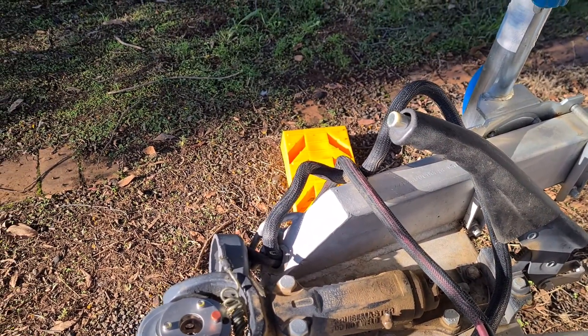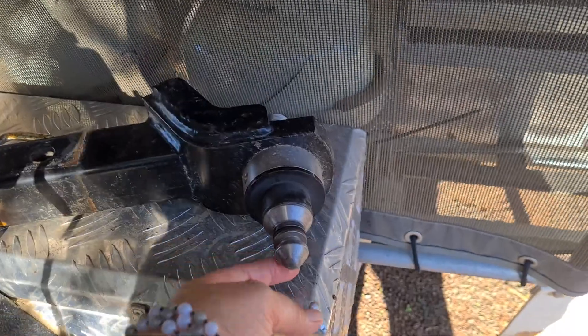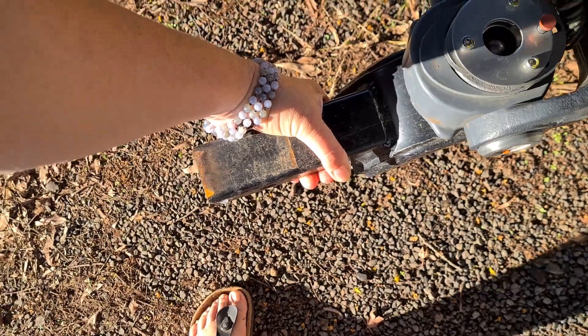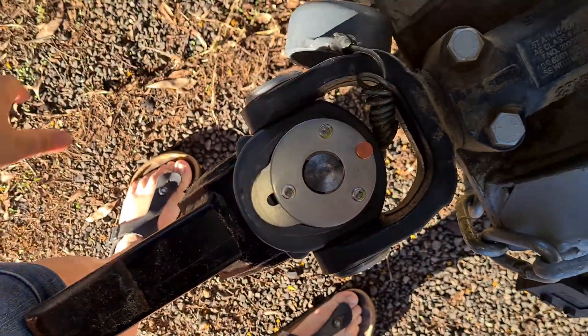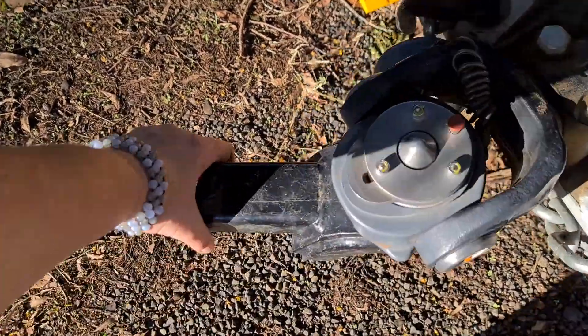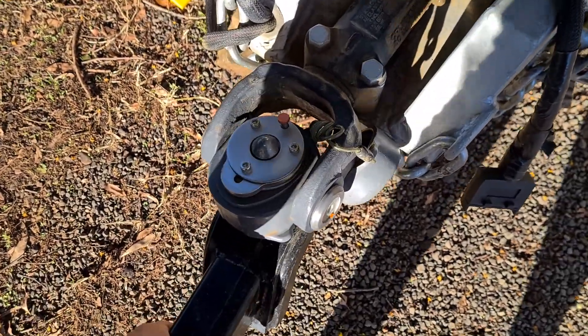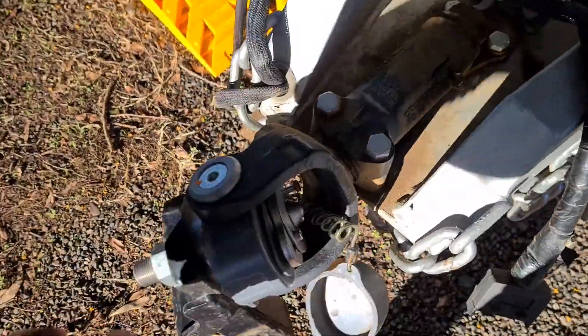This is what you plug into your car — it's a Ford connector with a red cap. You just back your car up, wind the jockey wheel down, drop it down through the pin, and she's locked in. This coupling is 360-degree — you can literally flip your trailer and it will not flip your car, or flip your car and it won't flip the trailer. It is fully mobile in every single direction. We've then got 7-pin flat, Anderson, and brake connections.